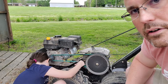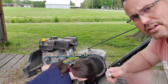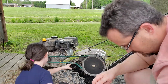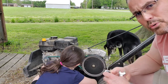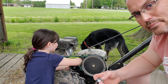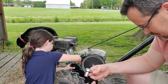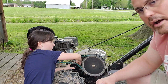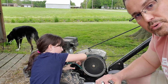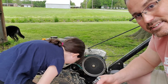While she's doing that, I'm going to go ahead and get her some wrenches ready. It's a 9/16ths on this one, so it'll be a 9/16th on the front. She's done what every person that works on stuff does multiple times — she's dropped the nut for the first time. This is common practice, folks, so don't be alarmed. The side story: I told mommy three times yesterday not to knock over all my bolts — she knocked over all my bolts and we had to do a search for about a half an hour to find everything. So she's tightening that up by hand. You want to do that first because that way you don't cross thread it. If you go in there and try to do that just with a wrench, a lot of times you might cross thread it. Even though some folks think that's nature's Loctite, it's not — because then you can never get it off again.